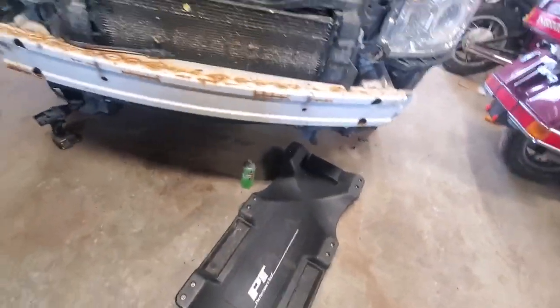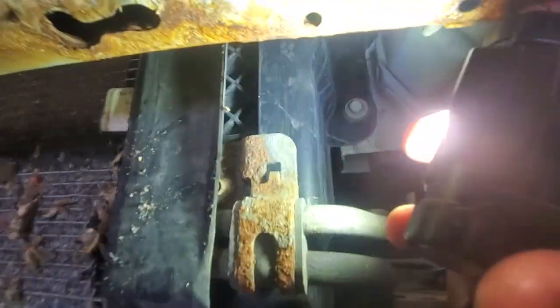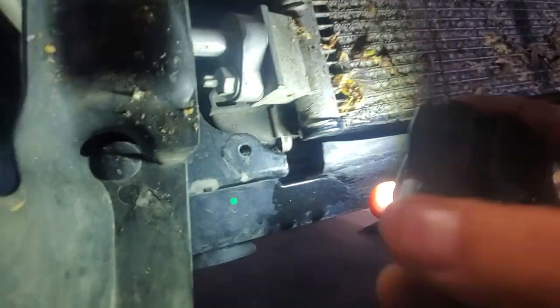What we went ahead and did is locate our intercooler, which is the second one. You can see it up top here — that one right there. If you want to confirm, you can find your charge line right there. Then you can follow that plastic line — it goes in behind, you can kind of see it up top — and you can see it right in there.